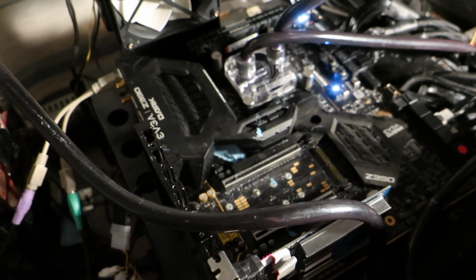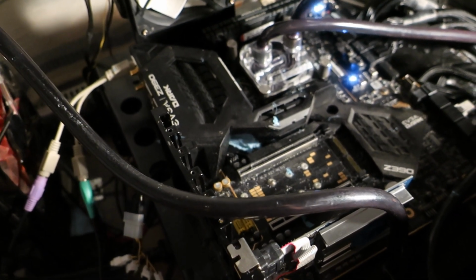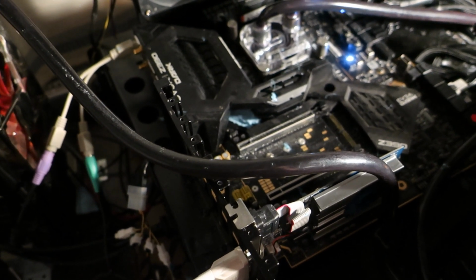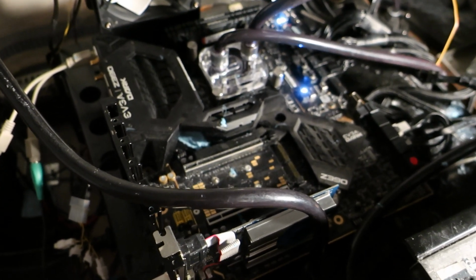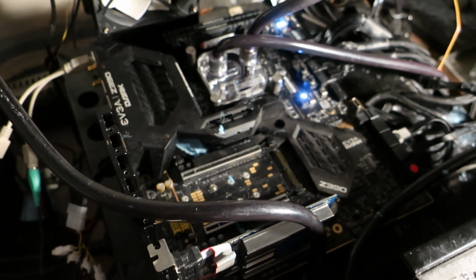Installing Windows 7 from a DVD on Z390 is pretty much the same as if you were running a 2600K Sandy Bridge platform. Of course, the only difference during the installation process is the lack of USB support, but other than that, it's very, very straightforward. So there's nothing you have to load during the installation process.